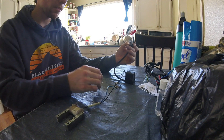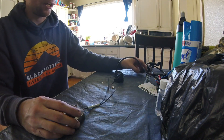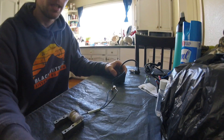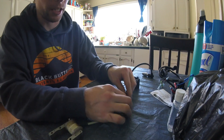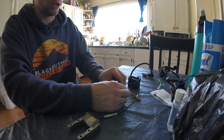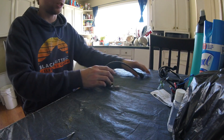The thing about these systems is, if you want your system to last the longest amount of time, you don't want to run the kill switch on these, as it burns out the wire — I believe this ground wire right here — and then you'd have to replace your magneto all the time. So that's the stock black box.